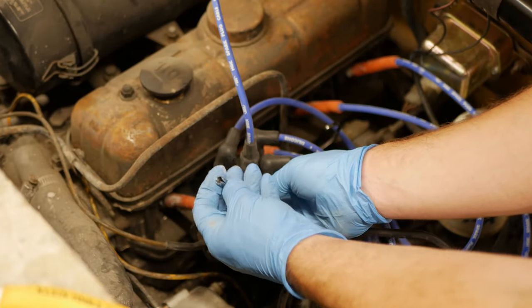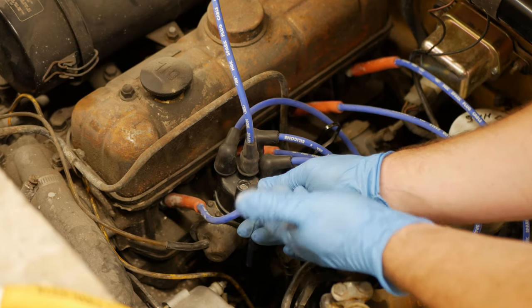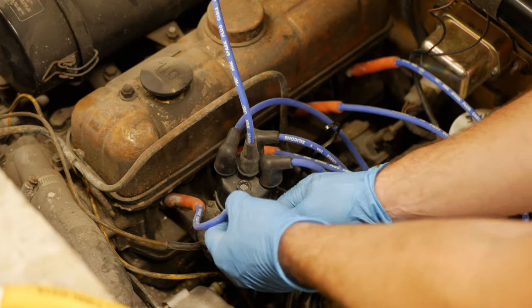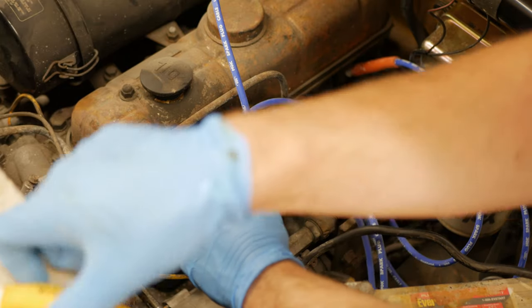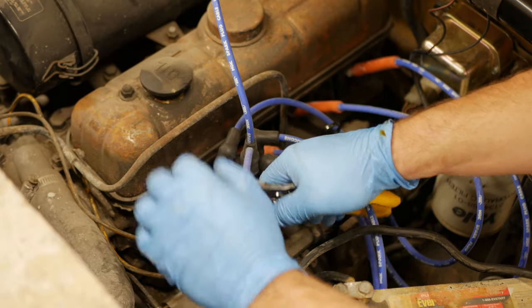Then after you get your little connector off, all you do is set your wire length. And I want these about as short as possible. So I'm just going to let this run long in here, set the cap where I want it, which is about right there. And then I'm going to cut and strip. So we're going to cut all the extra wire off.